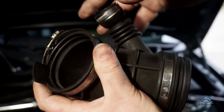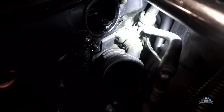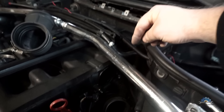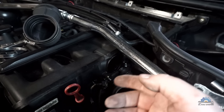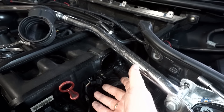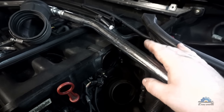You can see this jubilee clip facing up — the bottom one is the same. That's how they're supposed to be lined up, facing up. Next time you want to do this job it will be easier to reach with a screwdriver — long or short — without removing these panels. The reason I had it facing the other way is because I was removing that engine for piston ring replacement and wasn't paying attention. But if you're just doing basic maintenance, leave the clips facing up so next time it will be easier.